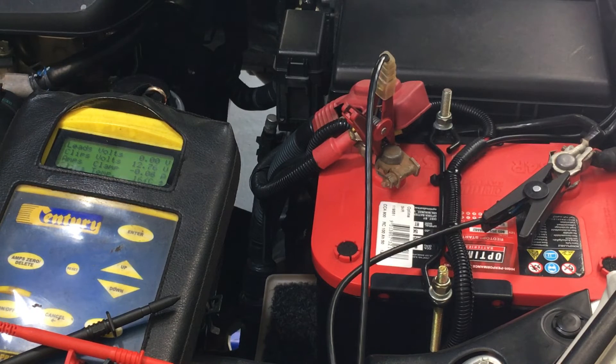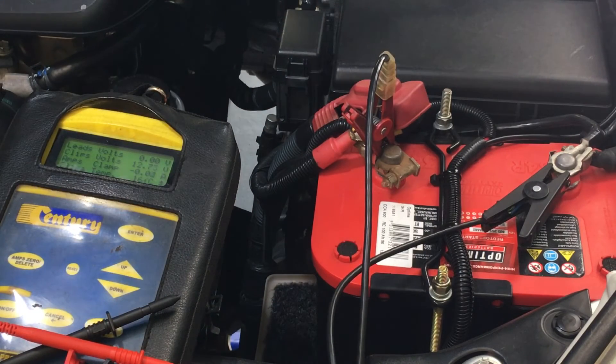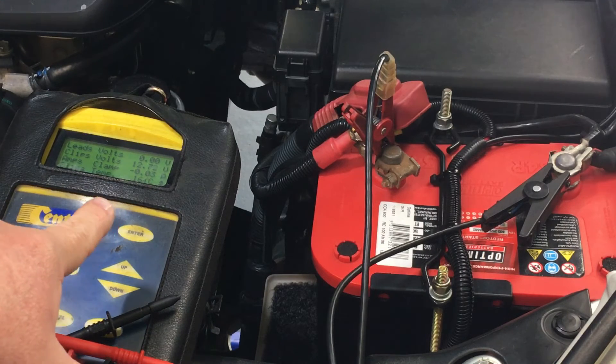Best way to look after your batteries is keep them full - think of it that way. Cycling the battery does damage it. So by having a fridge in your car running all the time, it's just using up your battery unnecessarily. When you park the vehicle, if you can plug it onto a charger to maintain it, that's even better - your batteries are going to last longer, and maybe that's why these last so long. You can see the voltage dropping down to 12.7 - obviously battery voltage. As soon as we start the car, you'll see charge voltage.